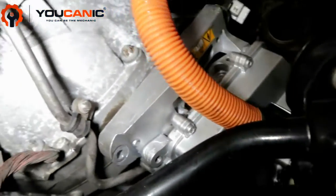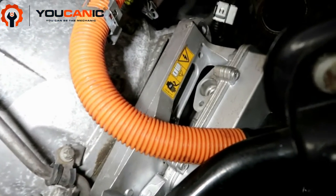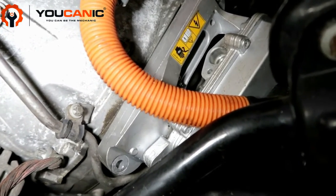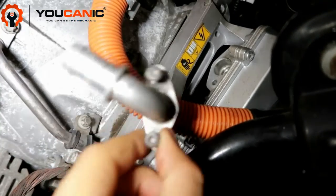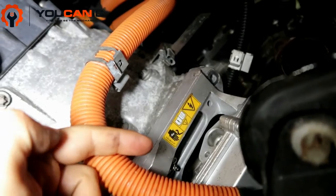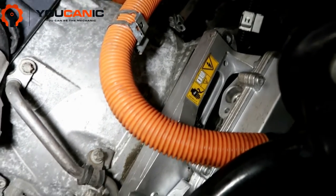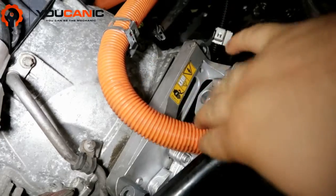Once that's done, you're getting ready to disconnect the connectors. First you have this piece — the interlock circuit. Once you remove this, it's supposed to disable the system as a safety measure just in case you didn't already disable it, to protect you from injury. Unplug that and the cover piece will come off as well. The reason you remove those two pieces is because behind them you have the high voltage connections going to the electric motor — there are three bolts there and two more bolts on the other side. Once you remove all those bolts and the two hoses, you can pull down the power electronic module.